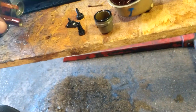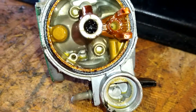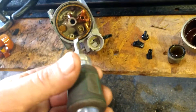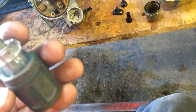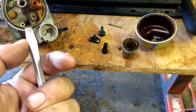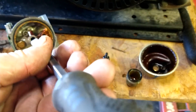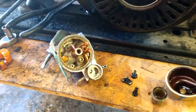If you didn't pull that out and clean it, it would surge like crazy. Now pull the main jet out. If it doesn't come out, we'll clean it in place. You need a narrow flathead screwdriver that fits in there. If you don't have one, take a number two flathead and grind both sides down to make it square so it fits right in — it'll work amazingly.